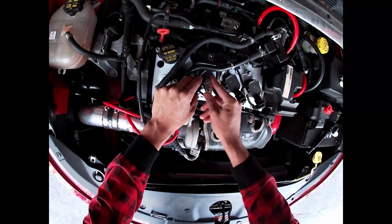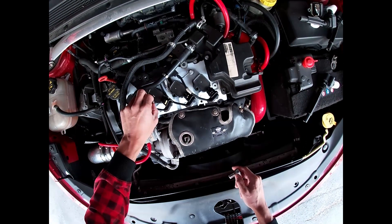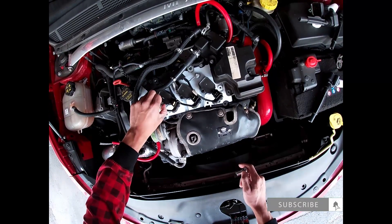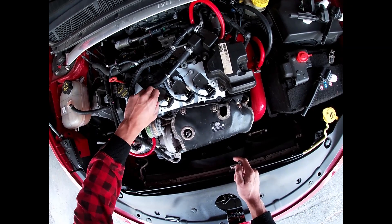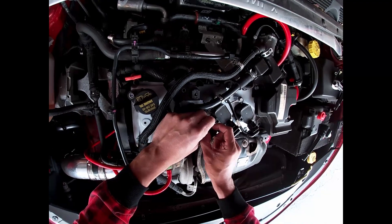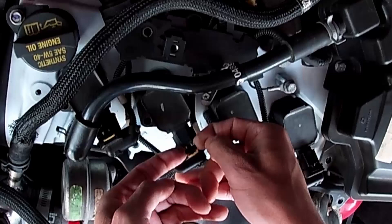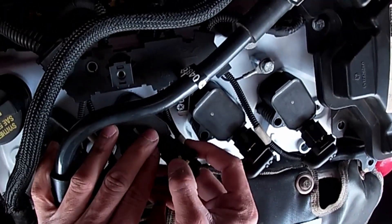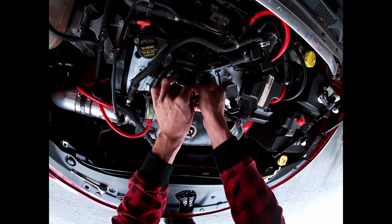I do know how to take them off — I know how to take the plug out. I'll show you guys how to do that so you can stop breaking the clips. Every Dart I've seen with this engine has broken clips. If you want to actually take them out, all you do is push in the sides. You see? And it slides out. Then you push down the black tab and pull.